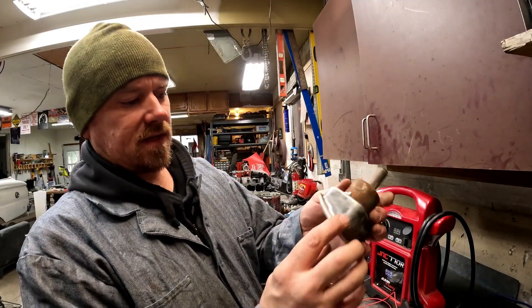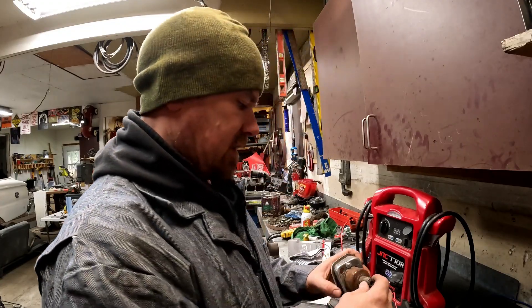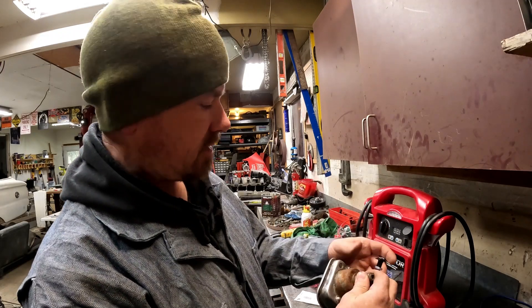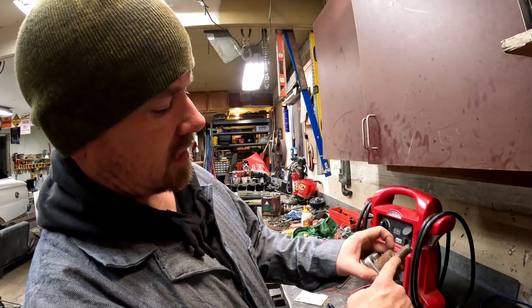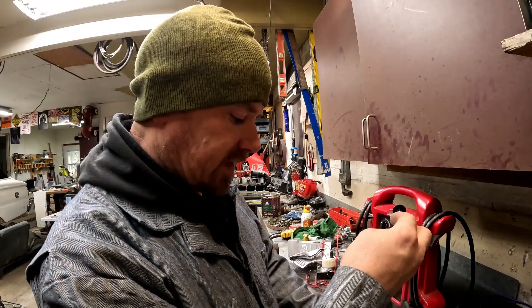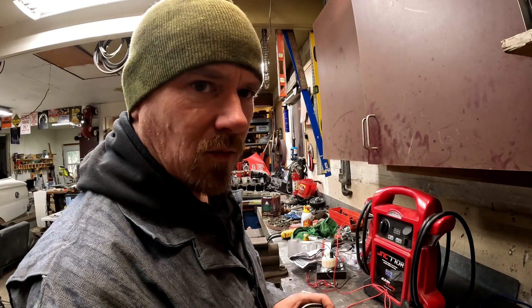I already had to fix one of these - the center piece comes out and I just put rivets in it. I cut new gaskets also. We need to get this bulb - not the clear one, this one - set in there like I did the rear tail lights. I'm just going to guesstimate; I'll cut above this dent where the bulb would lock in. I'm going to hack both of these off to make sure they're fairly square, then probably use a piece of rubber tubing.